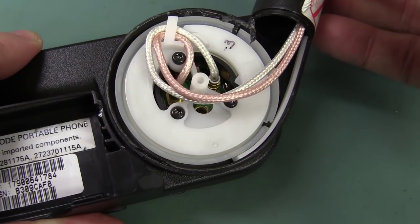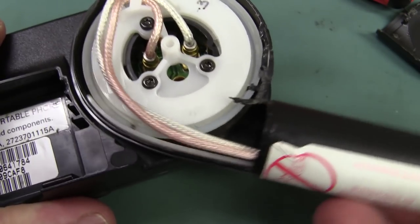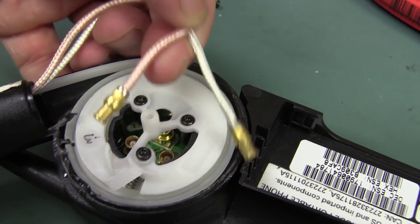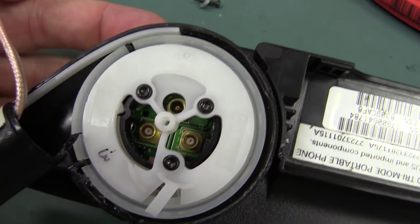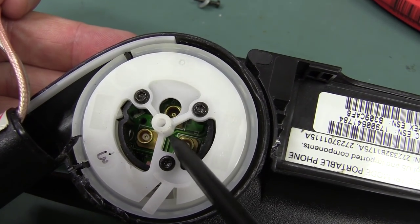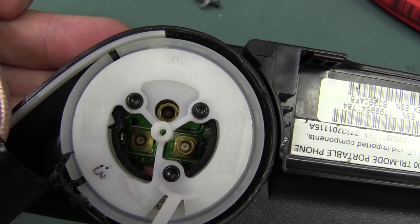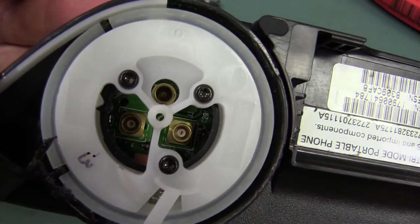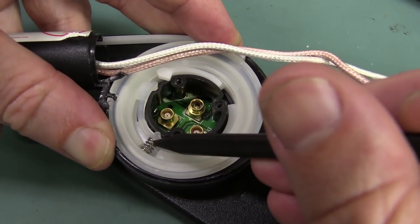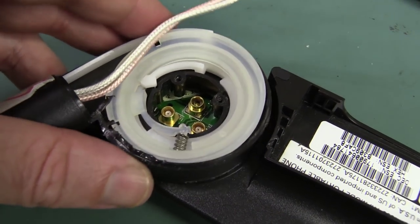There's a bit of strain relief in there, and there's an indent — there it is. They've got another indent around here as well and the second one pops in there. Nice. The antenna connectors aren't bodge-soldered onto the board either — they're nice little coax board interconnections. You'll notice three connectors in there: the antennas were plugged into this one and this one, but this one over here looks different — probably some sort of production test connector, or maybe for a different antenna type on another model.